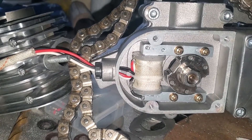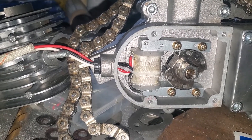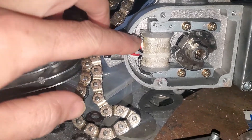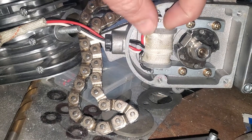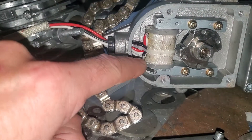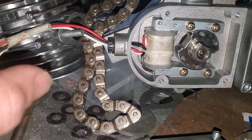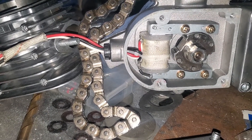It still puts out AC voltage, so you have to get a rectifier and regulator combo. You wire your new white wire and whatever black or ground wire you've got coming off the coil — that'll be one circuit going to your charging system. Then this wire and the ground or the base of this will be your ignition system circuit.